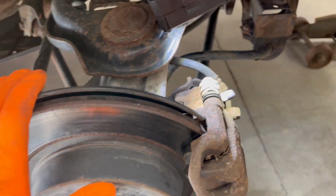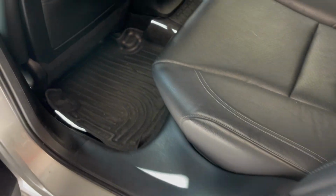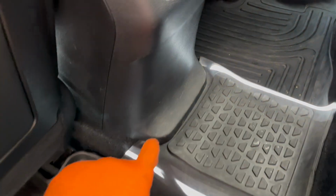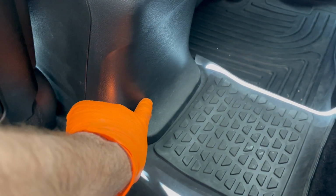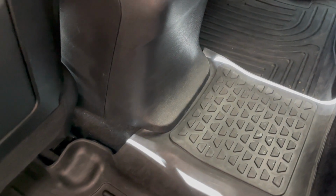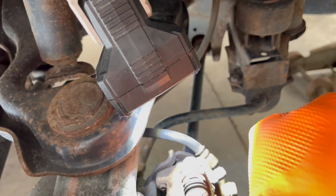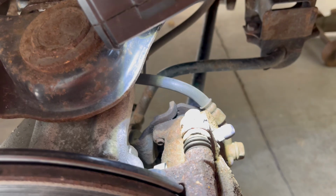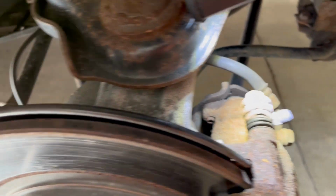This is a 2013 Honda Accord EXL rear brake caliper. There's some information that tells you that all you need to do is get into the rear of the console on some of these vehicles, and there's a 12mm nut in there, and it gauges the cables and takes up the slack because the cables are stretching. Cables in this instance do not stretch to that degree. If you've got a lever that's pulling a lot before it engages, that's the symptom that something is wrong. I'm going to show you what's wrong.